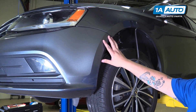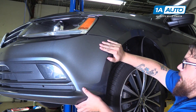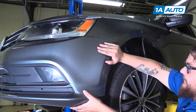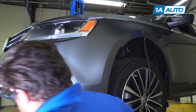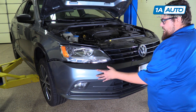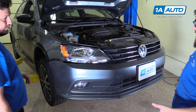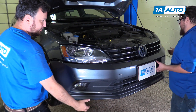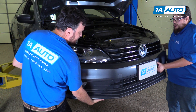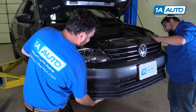When you need to remove the front bumper itself, there is a guide along the back of this bumper, so you're going to want to apply some pressure forward to get it out of the guide, and then it's all going to come straight out. To finish removing the front bumper after you've got the side guides out, you're going to want to pull forward. You may need a second person to assist in evenly pushing the front bumper out — it's clipped in.